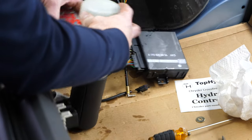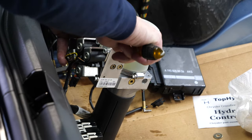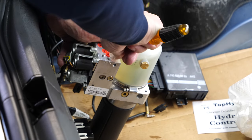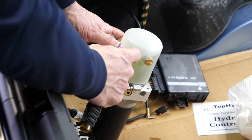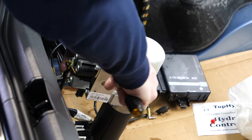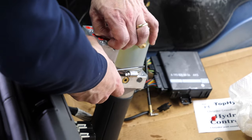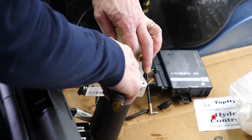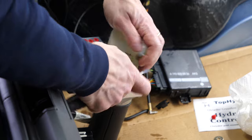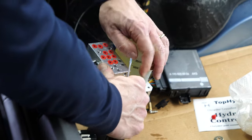I haven't connected the hoses yet. To connect the hoses, we take out the 14 plugs that came in the pump. Once these plugs are out, we put the manifold plate with the hoses back into place and screw it down. We don't want to force that plate down with the bolts — rather, make sure that every hose is properly seated so we don't do any damage.